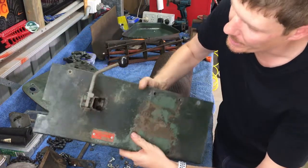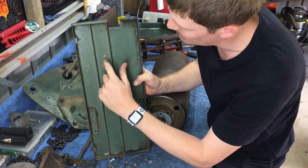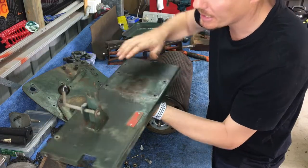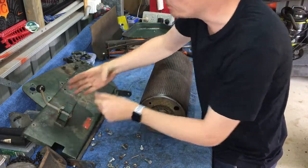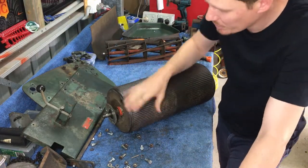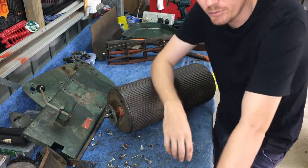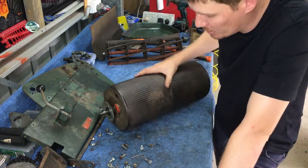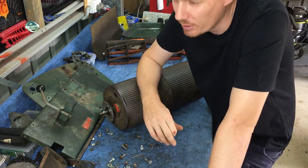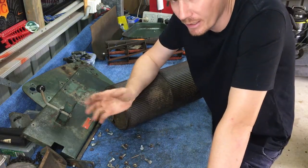The top deck is off. Our clutch fork is still assembled — as I mentioned earlier, there are three nuts underneath here, and I'll find it a bit easier to access them once the deck is actually removed from the mower. Our rear roller is still assembled. We will disassemble that — remove the bearings off the end and pull the complete roller apart. I can already hear, just by moving it on the bench, that there's a considerable amount of debris inside the roller. That's not uncommon — it's very common. It's just dry grass and everything; if your grass is wet, it gets stuck in there.